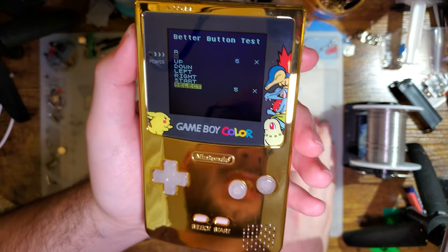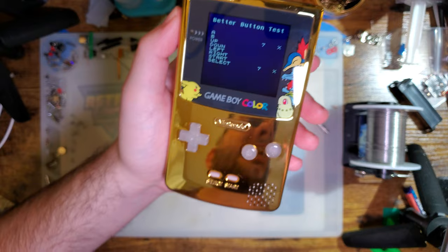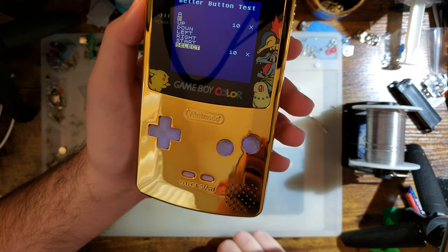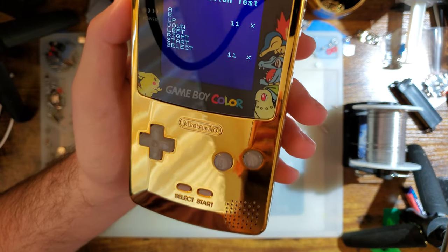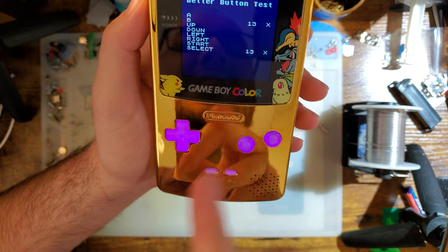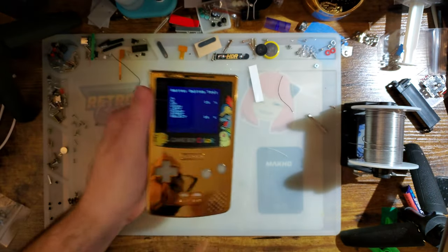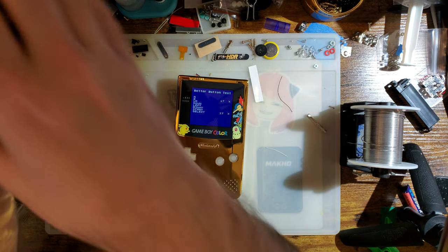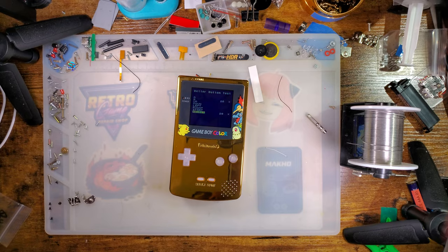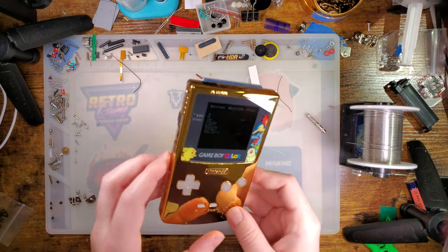I was happy with just the blinking lights, because I figured, that's fine. I'm not actually going to play with it. Who cares? But the problem is it never actually got the proper firmware on there. So every time the lights blink, it also toggles the buttons. So let's go ahead and get that fixed, because this thing is basically unplayable as is, what with not being able to use the select or B button anywhere.